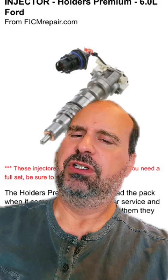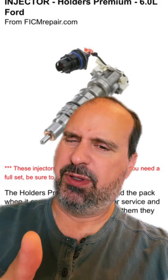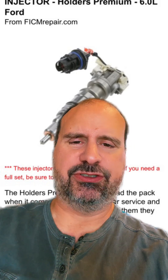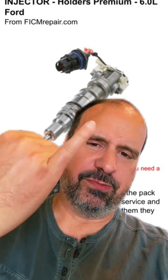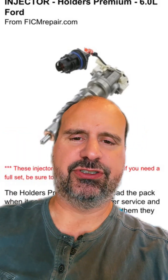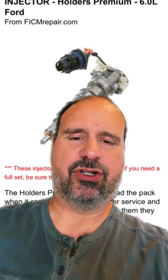So here's what you're supposed to do — we came up with a new version of this, so pay attention. Step one: hook up the battery charger. Step two: use the remote start engagement wire on the passenger side fender well just in front of the blower motor. Disconnect that little connector that's about the length of your pinky, take the free end, touch it to the positive post of the passenger side battery, and that'll engage the starter. All that is doing is engaging the solenoid — sending voltage there and nowhere else.